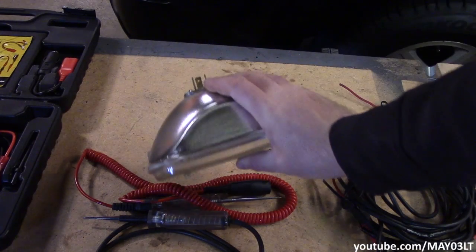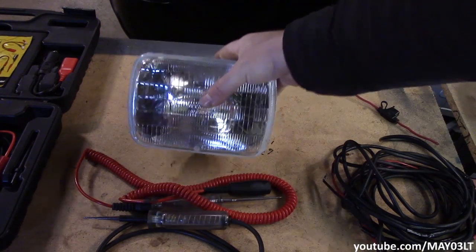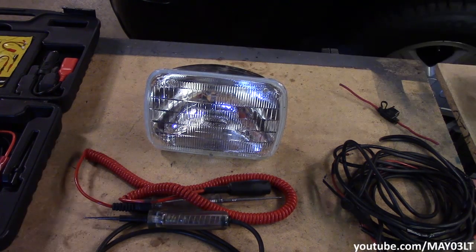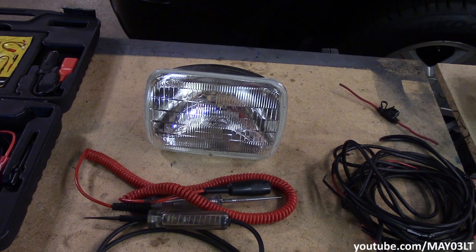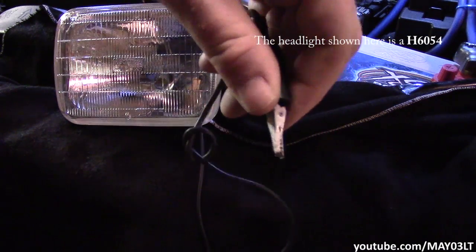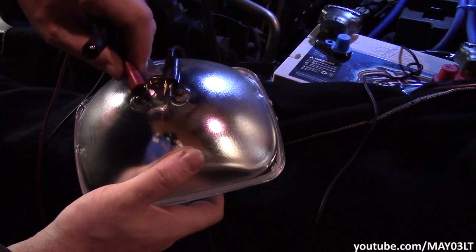What's this? A big-ass halogen, 6545 or something? As a test light? Hell yeah — that's what I call a super test light right there. And what I use this for is testing grounds. You might say, why would you use a headlight to test grounds? This headlight right here can put, on average, a four to six amp load on a circuit. I'm taking a little jumper wire with an alligator clip, clipping this terminal right here, connecting the other side with the other alligator clip to the battery positive. I have another set of jumper leads, so I'll just clip this guy right up here.